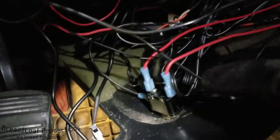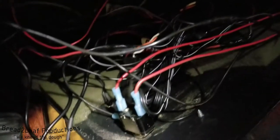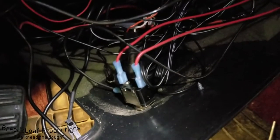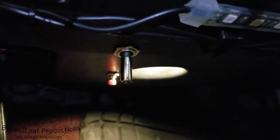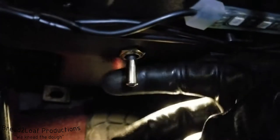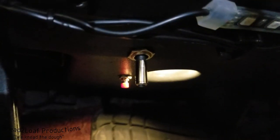Additionally, I have added a ground wire coming from this third terminal going up into the ground wire right here, and this just allows the light to turn on on the switch. And there she is, everything buttoned back up. This is what it looks like: turn it on, blue light's on, turn it off, and it goes off.